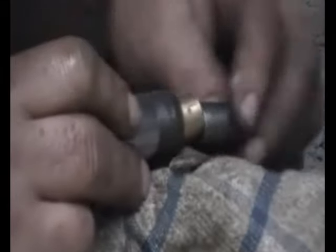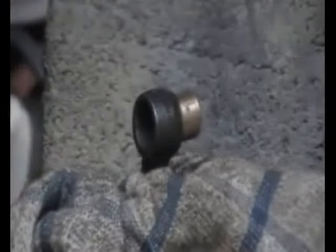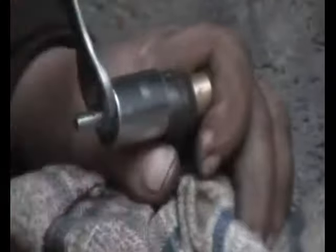Continuing on with the engine, the small bush is now put in as a reverse of the way it came out really. You use the socket to pull it into position, and in this case the bolt with the washer to pull against it. Does that make sense? Anyway, as you can see in the film, it's a straightforward case of tightening up the bolt and pulling the little bush into position.